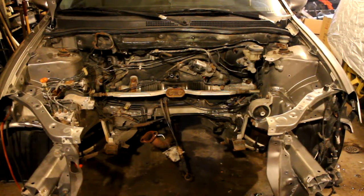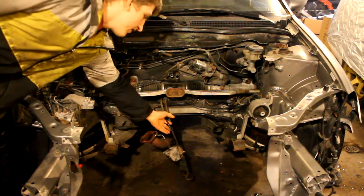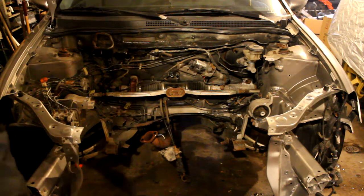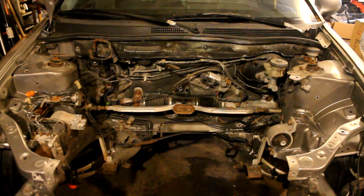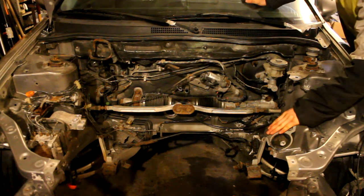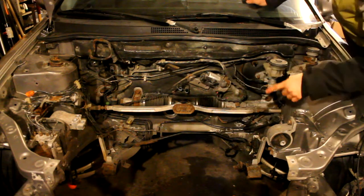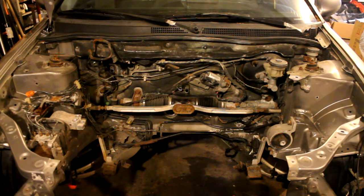To start I'm going to do just a little cleanup of the engine bay. I'm going to go ahead and remove the exhaust, the shifter cables and bracket, the old engine mounts and just a few loose hanging brackets. Now that those two items are off I'm just going to keep working away. I'm going to take off lots of little things like the engine mounts. There's a bunch of random brackets that I'm not going to need anymore. Some cables and then eventually I'm going to get to the brake lines as we will be replacing all the brake lines on this car.